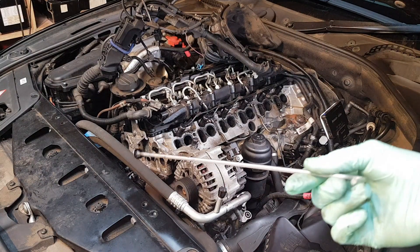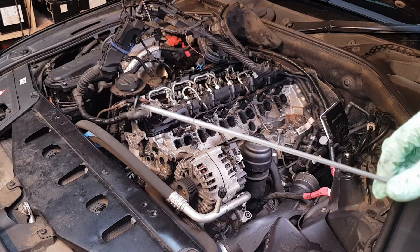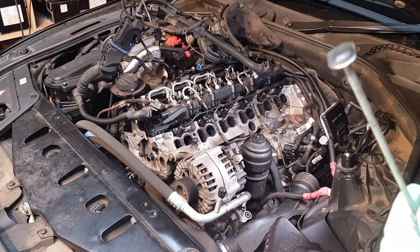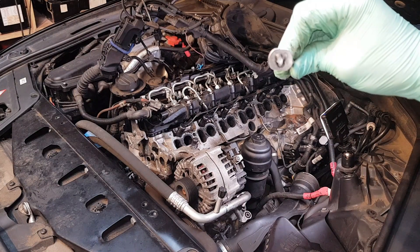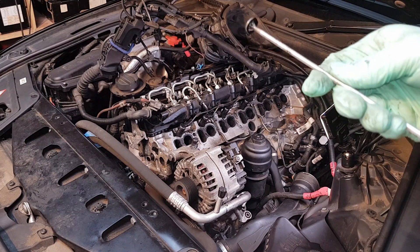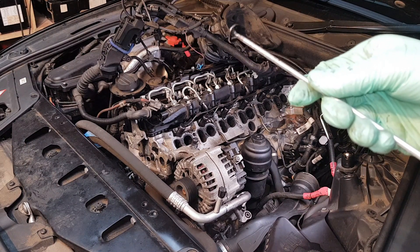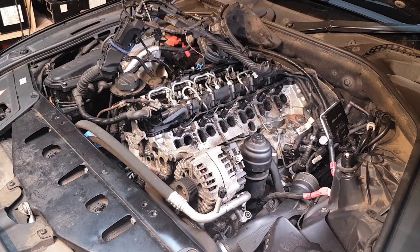This is what I came up with. Just got a strong piece of metal that I had lying around in the garage. I got a washer, welded the washer and then I just ground the washer to profile just to fit the ports as best as I can. So now I have an oval section and a more flat section to kind of drag and pull and remove the debris.